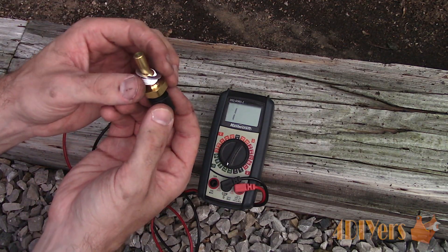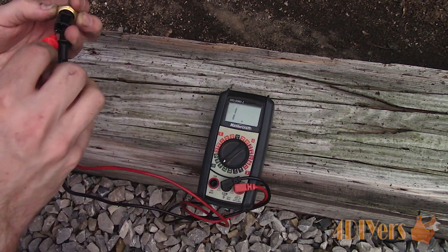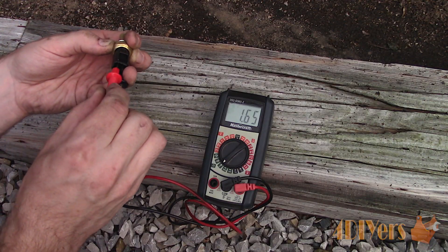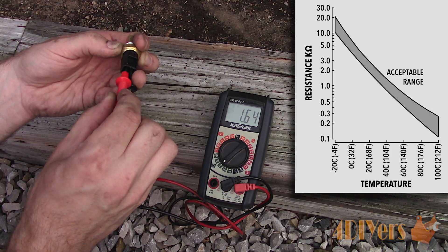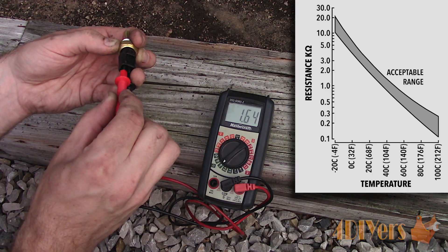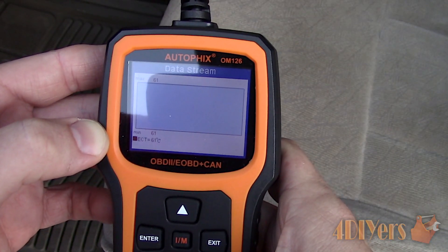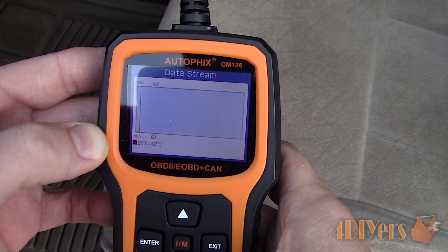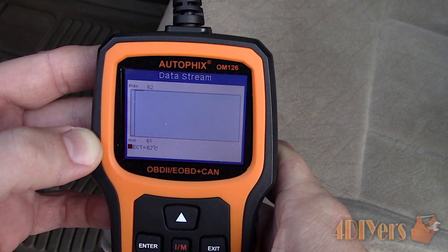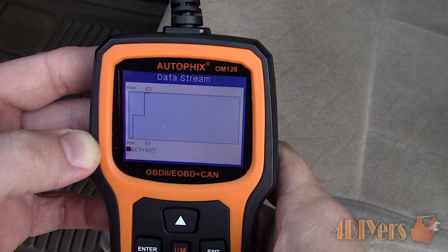Here is the new sensor. Using the new sensor as an example while doing a dry test — a coolant temperature sensor should be tested in hot water at specific temperatures. Based on the temperature, referring to a chart, you are able to see what the resistance rating is at a certain temperature. Another way of testing the sensor or circuit is by using an OBD2 code reader which can monitor live data. While the vehicle is warmed up, you should see the temperature of the engine increasing. However, this test does not specifically test the sensor, but instead the whole circuit.